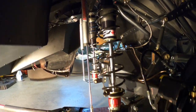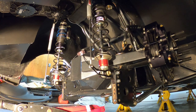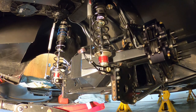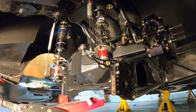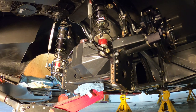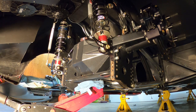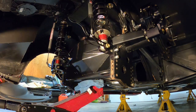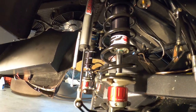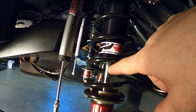Sensors are in, let's give it a try and see if we lift them up. When fully extended, we want to make sure the sensor doesn't bottom out. It's at about the right height because it's lifting the chassis. This sensor is about eight inches of travel, so you can see there's quite a bit left.